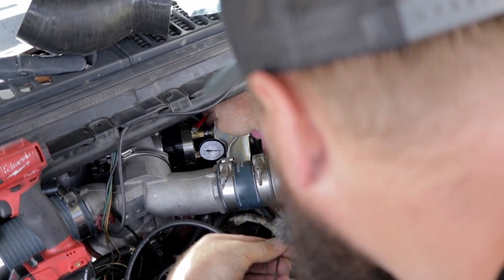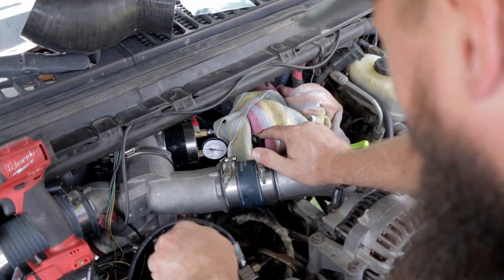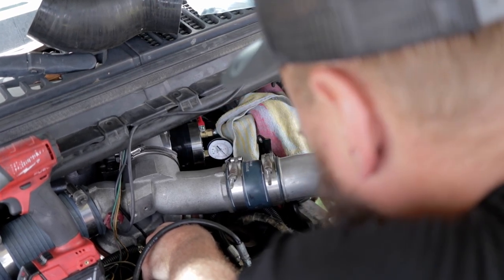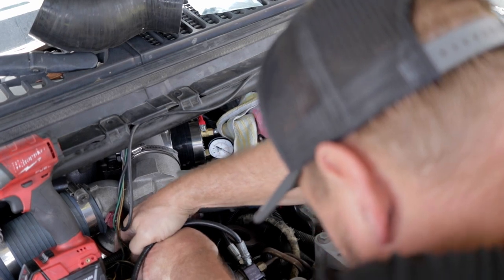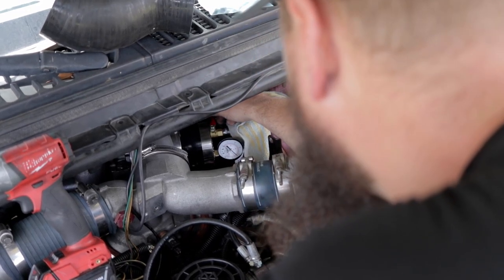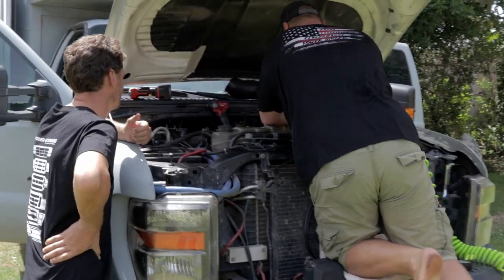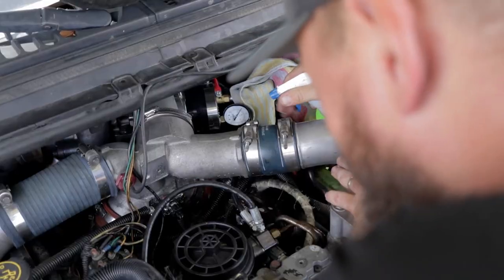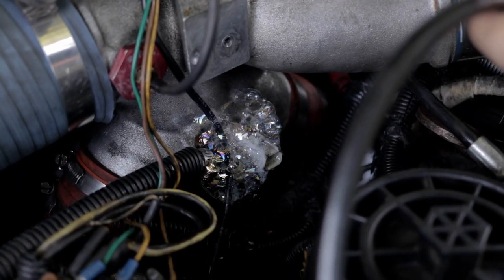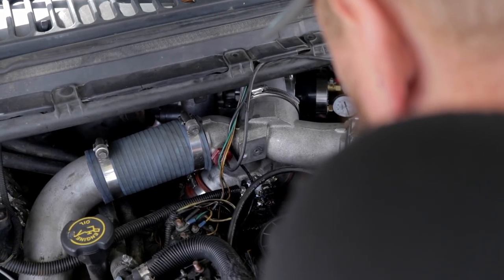So I'm holding 15 or 20 PSI here on my bodgered gauge, but I'm going to put this mic down in the valley and you can hear a little leak. Time to get out the soapy water, I guess. That's a bit much. Well, yeah. Okay. Once again, into the breach. That's good. Ah, there's a leak. Oh, yeah. Right here, Kara. Yeah. 25 PSI.